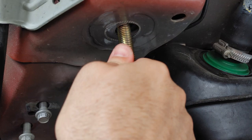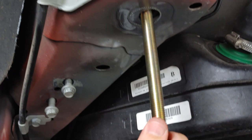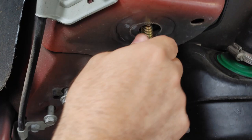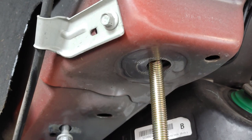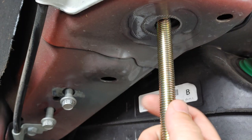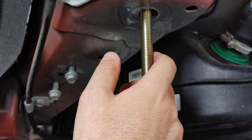Here's the driver side front on this car - it's pretty much a virgin, I haven't even tried it yet. See, this is the only one - I'm turning as hard as I can and it's gummed up. All the other ones went in by hand, just like this, but this one's gummed up. That's your example right there. This is exactly what happens in shops - the bolt won't go in, they think they cross-threaded it, they take it in and out, gum the threads up even more, then jam it home with an impact and it's screwed.